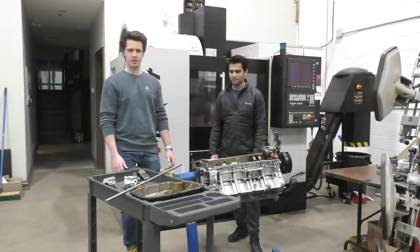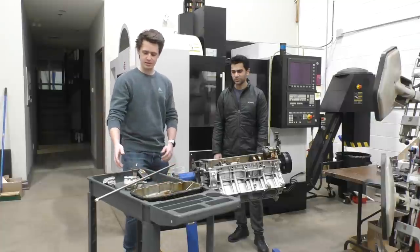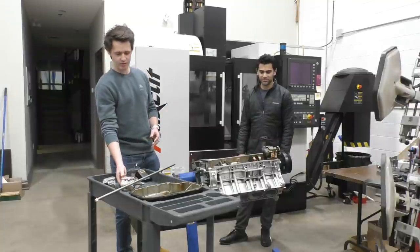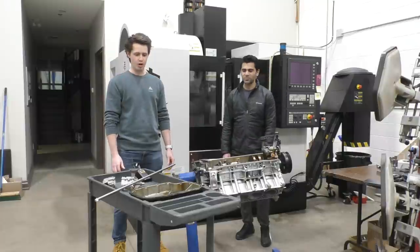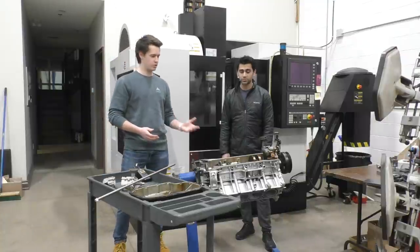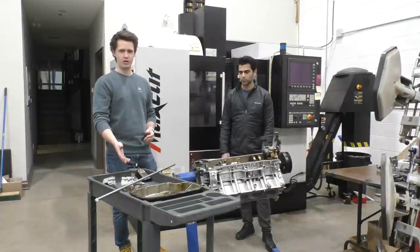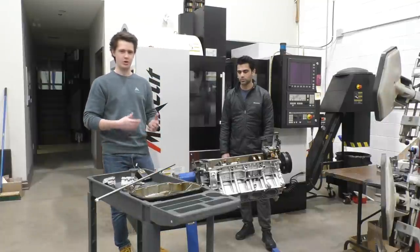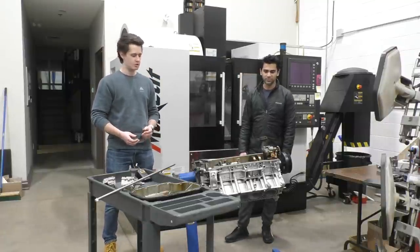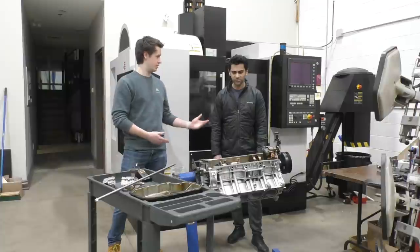Yeah, so most cars typically have a wet sump system, which means oil stored at the bottom of the engine in a collector like this, and sucked up through essentially one stage that then cycles it to the engine. The issue with that is now you have a lot of oil sitting at the bottom of the engine, which means it will move around as the car moves. So when you're on the track, the oil will essentially move to different parts of it and may not go into the collector, which leads to air coming in, a loss of engine pressure, and you may not have the reliable performance that you need. So there's lots of benefits that come with the dry sump, and that's the design that we're going to run.